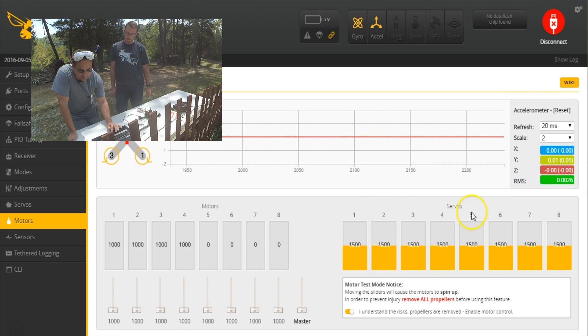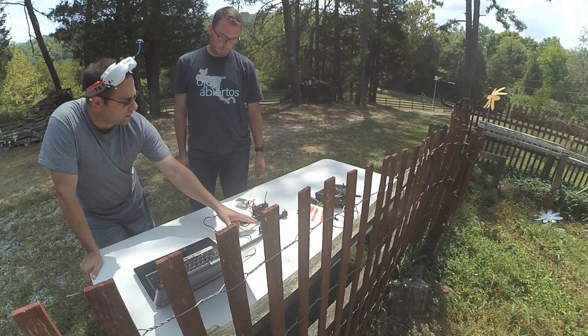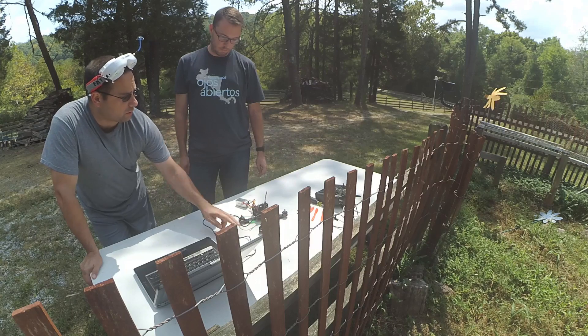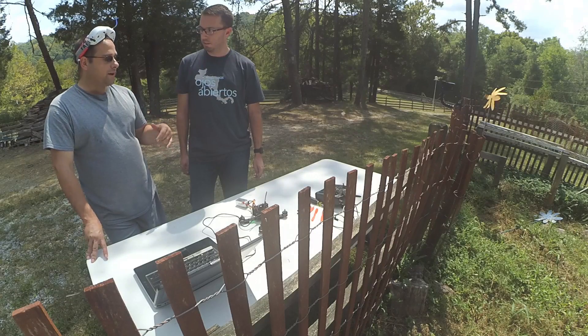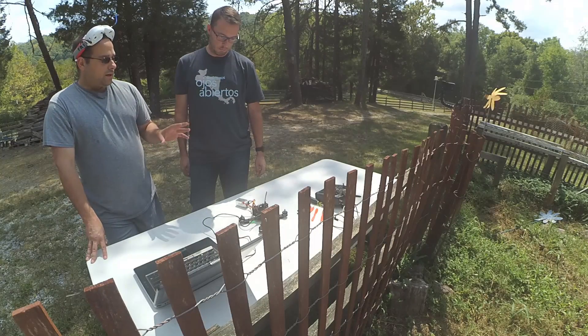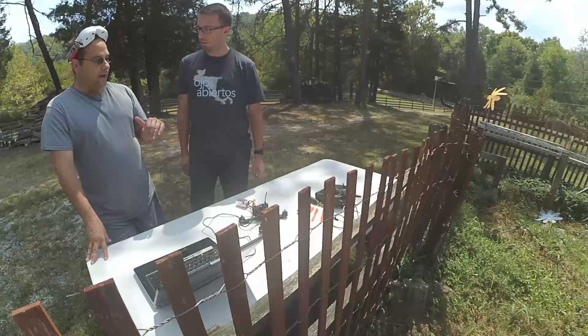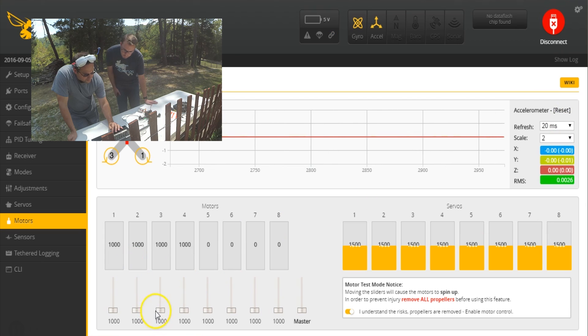Now I'm going to reset again and raise it — looking good. I am not leaving it at max for very long with the props off. What ESCs are those? It's the XM20A — so the F390. You're okay there. But even still, with the props off the motor RPM may be high enough that, especially on an F330 ESC, but even on an F390 or a BLHELI S, you can get a sync issue or hit the rev limiter. If you go to max and hear the motor going tick tick tick tick, you want to back off. That one's fine.